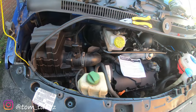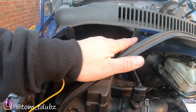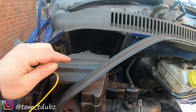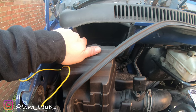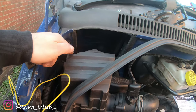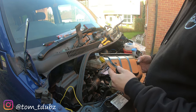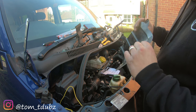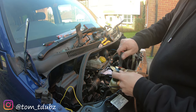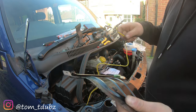It can't join the existing loom which runs down and round because it's not quite long enough, so it runs along the top and plugs into number two on the other side. This part of the cable I'm going to feed from my main switch inside the van. I've taken off this panel — two Torx screws, one underneath here and one underneath here — and there's a small grommet, so I'm going to make a little hole in it and poke the cable through.